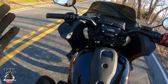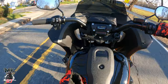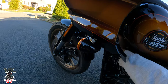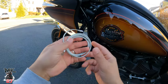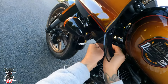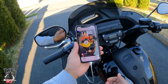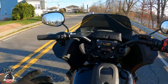Let's start with number one: the USB port. Most all Softails come with a USB port — it's always going to be on the left side of the neck of the frame. If you come over on the left side of the bike, right in front of the tank, this cap right here pops open. That's where you plug in your charger or whatever you are connecting to the bike, then run it up to wherever you're going.